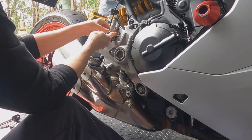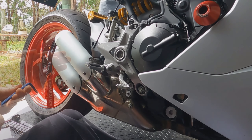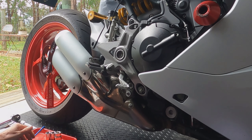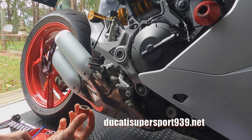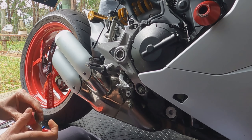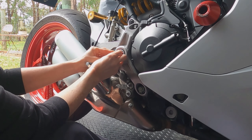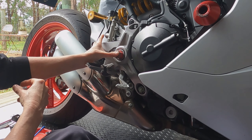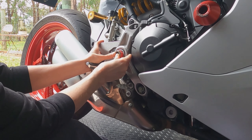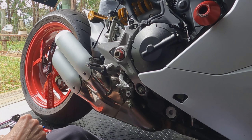That feels relatively free now. On the Supersport forum, someone posted about using a welding of two 24mm nuts together to fit in here. I happen to have a coupling nut that's exactly the right size — my husband put a bit of tape on it just to give it an extra snug fit and to not damage anything. If I get that in very gently, it just gets into place nicely, so I just need to get the right socket to undo that.